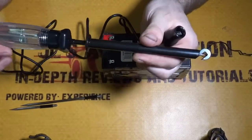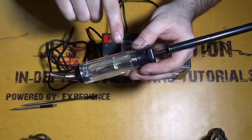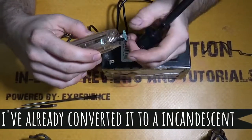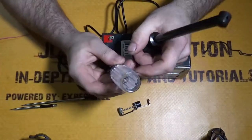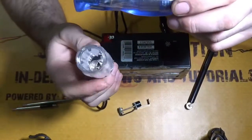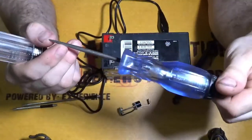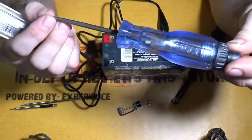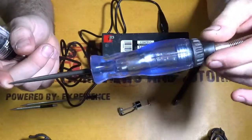I'm actually quite impressed with it, and the probe is spring-loaded which is nice. One thing I'd suggest if you're not a fan of LEDs — you can actually remove the internals; there is a spring inside. You could get a longer spring or take an old incandescent test light you have and swap the internals over, giving you an incandescent test light with interchangeable probes. This old test light I've had for about eight or nine years and the bulb actually just burnt out on me this year.